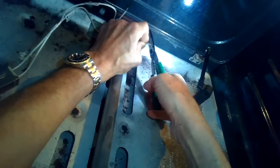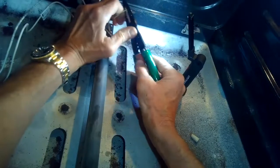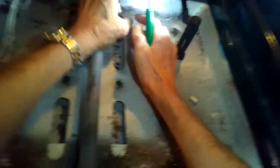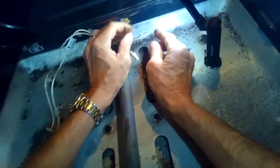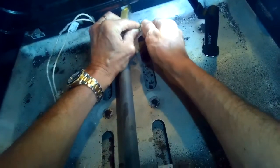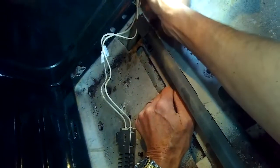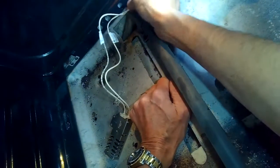There's no polarity issue, so you can put either of the power wires from the oven to either of the wires on the igniter. You can't short circuit it or do it wrong unless it touches the metal, so make sure you have the wire nut on there securely so no part of the wire could touch the metal. I'm putting the other two wires together — one from the oven and one to the igniter — and putting on the ceramic wire nut, getting it on really tight. If there's any oil left on the threads or anywhere around, try to dry it off because when it burns it does make a bad smell.